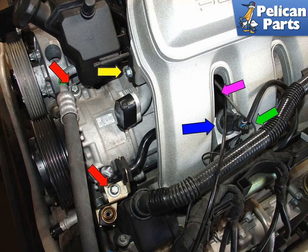The sensor sits in a rubber sleeve that fits into a groove on the intake manifold — it's difficult to see, but it will slide out. You can now access the remaining compressor bolt from in between the intake manifold, purple arrow, using a combination of extensions and U-joints. This bolt needs to be held in its upward position to remove the compressor. Once the compressor is free, unplug the electrical ground connector, green arrow. Lay down a rag or towel to protect the paint and lay the compressor off to the side of the engine.